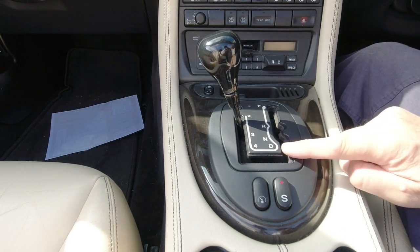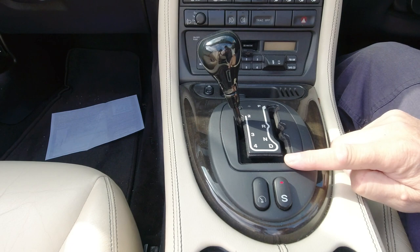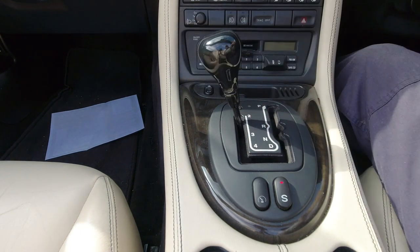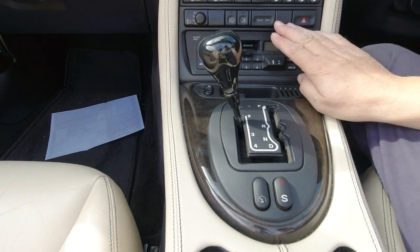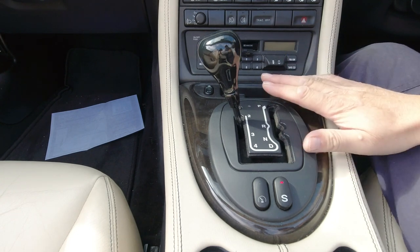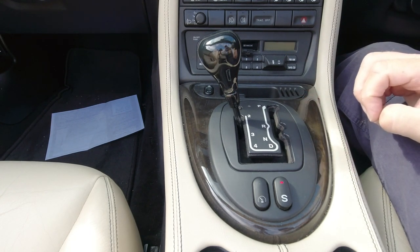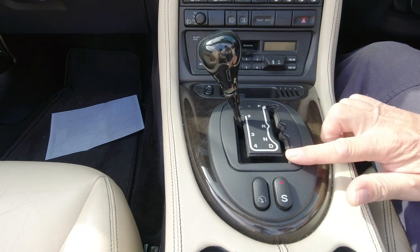D masks that torque and responsiveness massively. If you enter a bend, slam it into two, and then floor it on the way out, you will find you've got an entirely different car. You will feel the rear end squirm a little bit, even with the traction control on. You will feel that instantaneous torque and acceleration, uncushioned by the programs that are running in D.